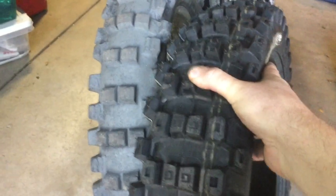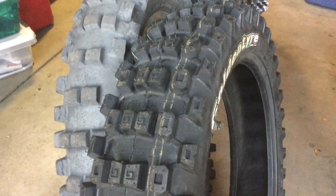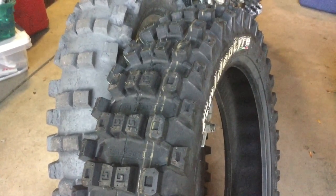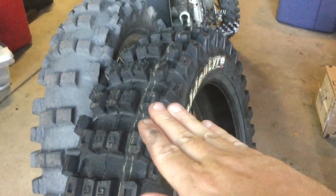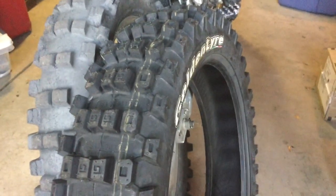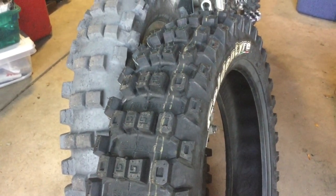The crown of the tire you can push right down, whereas the sidewall is really stiff and you can hardly move it — which should make mounting fun. The Golden Tire rep says the GT333 is designed to be effective at higher pressures or with a Moose tube. So even at 12 or 14 PSI, the crown of the tire should flatten out on the terrain and give a nice big contact patch, while the stiff sidewalls protect your tubes and rims.